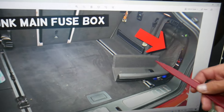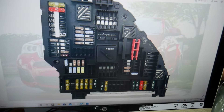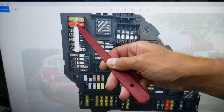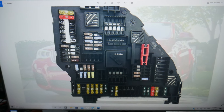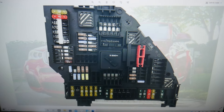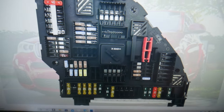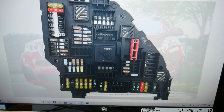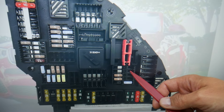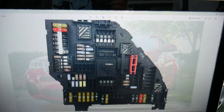There is another fuse box in the trunk. Remove the cover on the side, lift that insulation, and underneath you have that fuse box. Zooming in, we need to check fuse number 101 — a very important fuse — then fuse number 107, a 5A fuse. You also need to check fuse number 140, which is a 5A fuse. Then check fuse number 173 — you may or may not have all of them, but if you have it, fuse 173 will be the second fuse that you need to check.